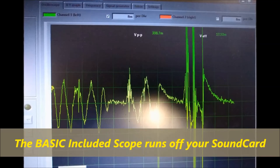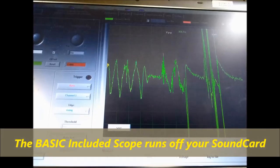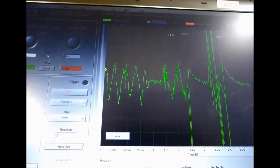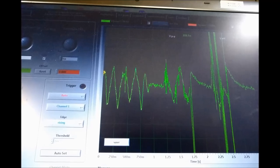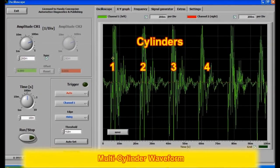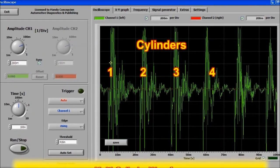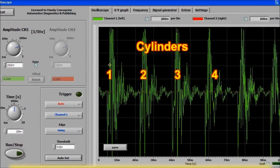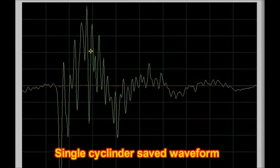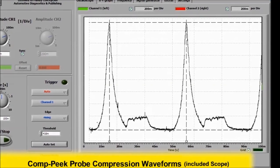This is the hardest part of the video. Basically, this is a single cylinder saved waveform — this is what a one-cylinder waveform looks like. This particular waveform has an issue, but we're going to go through it in a couple of minutes. In this particular waveform, you can actually see a complete rotation of your piston, of your crankshaft. These are 180-degree-spaced intervals or divisions.